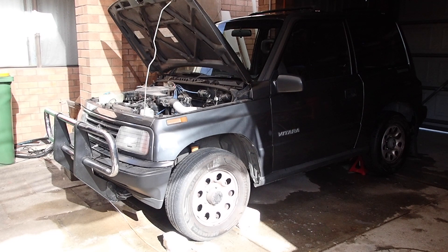Last week I was in a car park watching some young guys trying to bump start a car. And I thought, what are they doing? When you bump start on a hard surface rolling along, you slip it into second gear, get a bit of velocity to the car, pop the clutch out with the ignition on and hopefully she starts — providing that your problem was just the starter motor. The guy in the car was sitting there turning the key expecting something to magically happen as his mates were having a small coronary. So Poppy here had to step in and show him how it was actually done.